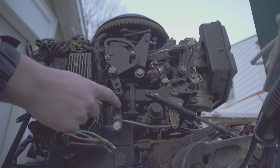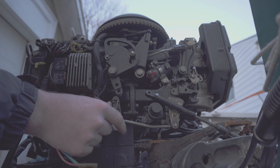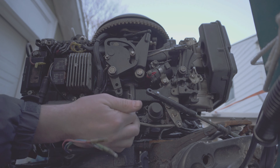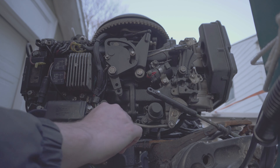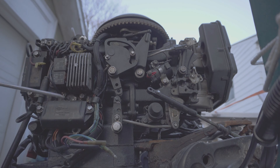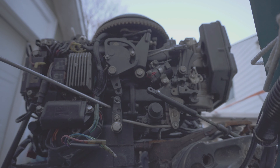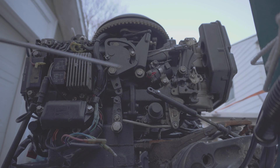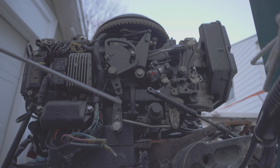The way the shifting actually works, it doesn't move slowly — it is basically a popping action. It pops into place like that. That's forward or reverse and neutral. This is why adjusting the throttle cable itself slightly won't really do anything, and if popping the gear into forward or reverse doesn't work, you likely have an issue inside the actual controller or, most likely, inside the gearbox down below.